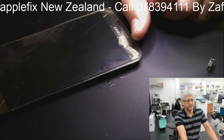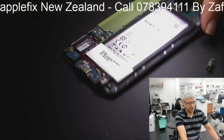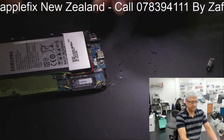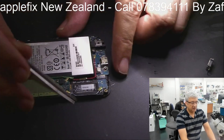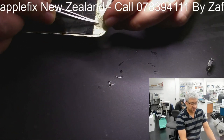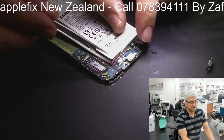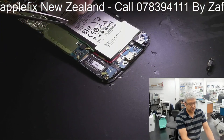I thought maybe I should share a video with you on how to do this repair easily. So the LCD is working, all good. This is the broken charging port - this is the whole flex cable. But this flex cable also has the home and back button which is underneath the screen. You just can't replace the whole cable. And these boards with the flex cable are a little bit fragile, not as strong as we are working on the logic board.